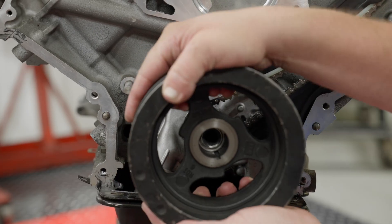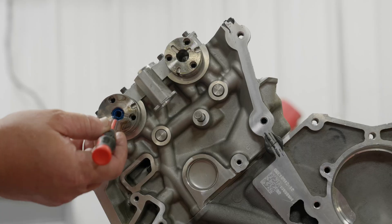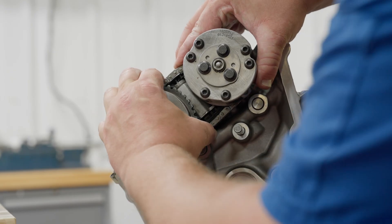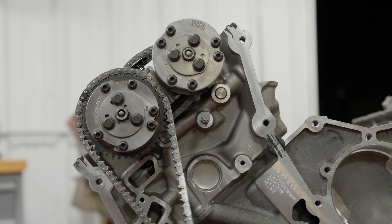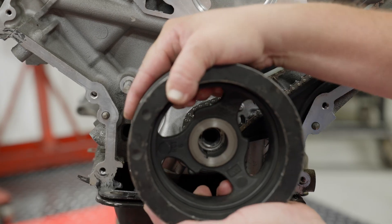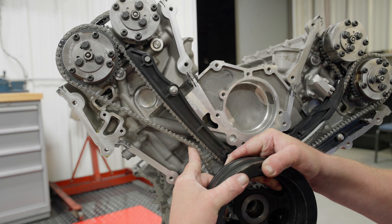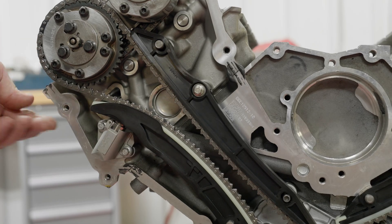Now we're ready for right-hand bank assembly, but we must first rotate the crankshaft keyway clockwise back to the original 730 starting position. Install the oil supply screens, the secondary tensioner and guide, then the phaser and chain assembly. Don't forget to activate the secondary tensioner and torque the phaser attachment bolts to specification. Now install the right-hand primary chain. Align the upper marked link to the R mark on the exhaust phaser. Slight crankshaft movement can be used to align the lower timing marks. Once aligned, install the chain guide, tensioner guide, and the tensioner, slightly shifting chain slack as necessary to install the components. Torque the attachment bolts to 89 inch-pounds. Recheck the alignment of the right-hand timing marks, then activate the right-hand tensioner.